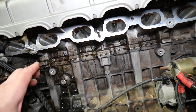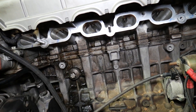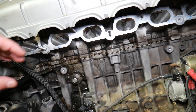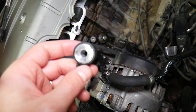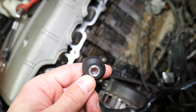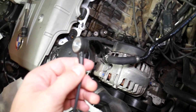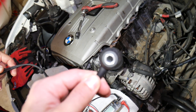What the knock sensor detects is early explosions in the combustion chamber — meaning the spark was ignited a little bit early, and as a result it creates that knock. The engine will not be running well. The sensor is kind of like the earphones for the engine computer — it listens for that knock in the form of vibration, because when it knocks it creates vibration on the engine block. It will then signal that we need to adjust the ignition timing to fix that. It's a very important component.